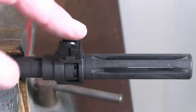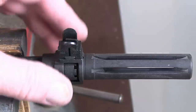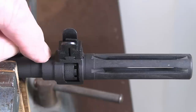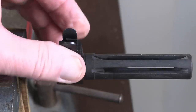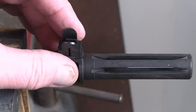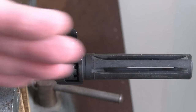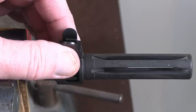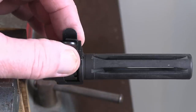The front sight and flash hider assembly of an M14 and M1A is mounted on a splined barrel. There are three splines cut into this barrel — you can see the end of it right here. On many rifles, you'll have a tight fit, but it's not uncommon for those splines to be a little bit larger than the associated key that fits into them, and the key inside, if it's got any slop to it whatsoever, it's going to cause a little bit of radial slop. That's not likely to cause significant group changes. If you're firing a session of 20 or 30 rounds, most of your inertial forces are fore and aft, and very frequently a pretty tight installation, even though it has some radial slop, will stay put.